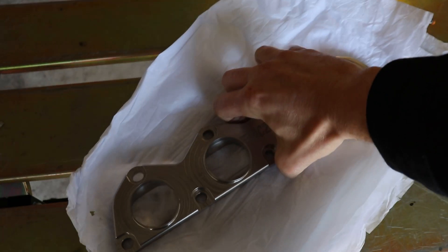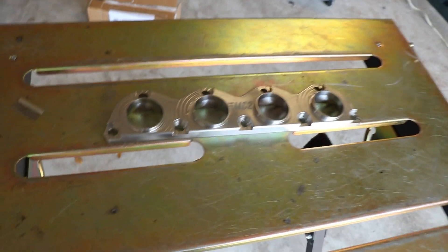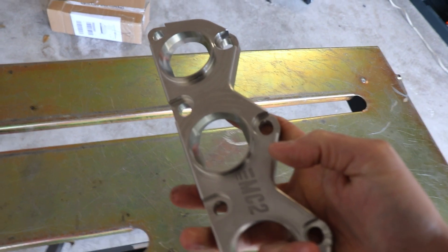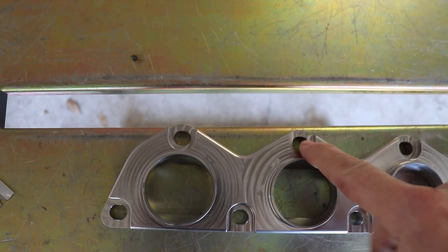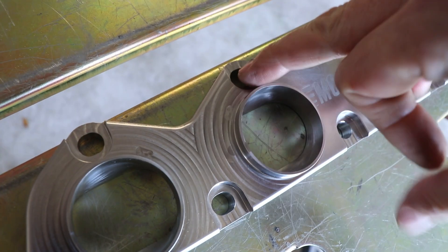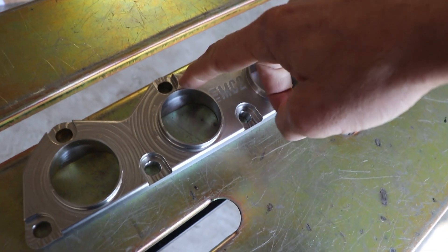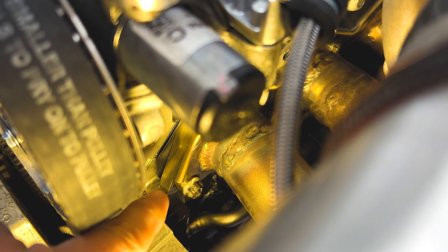Let me know what you think down in the comments — that is the reason why I redesigned this flange and had another prototype sent over. It does have a nice flow from the shape of the head casting to a 1.5 schedule 10 transition, very nice and smooth. I had them open up the recesses a little more because it was hard to get hardware in there to actually bolt up the turbo manifold flange after I designed it — I would have to take a nut and kind of cut it down. So I had them open that up, and you can see the hardware here where I had to narrow its diameter to make it work.